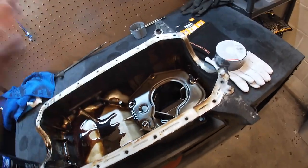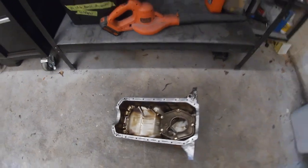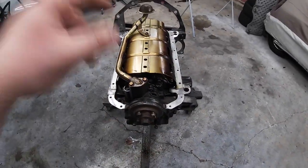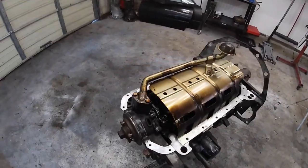I'll be back after a bit. I've got the oil pan cleaned up — it looks pretty good. I did spray it out with brake clean; make sure you do that, especially if you're using the wizard wheel, which I ended up going with. It will take off the littlest bit of metal, so make sure you brake clean it afterwards. I'm going to brake clean it now, flip it over and let it drain for about five minutes, then flip it back over, wipe it down, and start using some RTV. When you're brake cleaning it, try not to hit the rubber as best as you can.